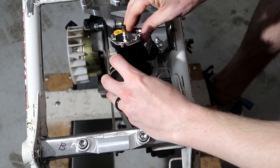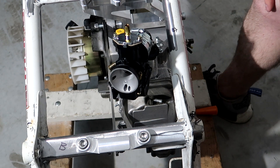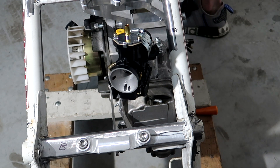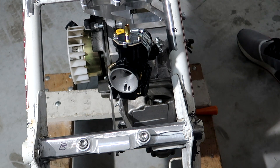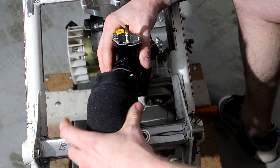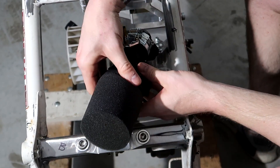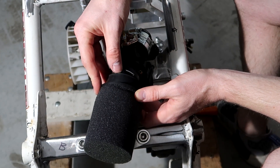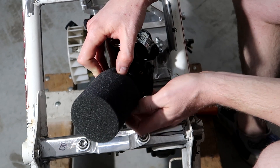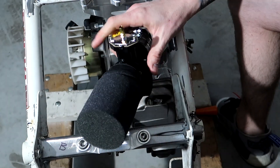There we go — got the carburetor in there. I'm going to try a spare filter on it right now. I'm stealing parts off the black and gold bike — I'm going to slide this over like so. I might have to get an angled one that points the filter at like a small 40 degree angle, pointing downward to give me as much room as I can. But that's why I'm doing this — so I can test for fitment.